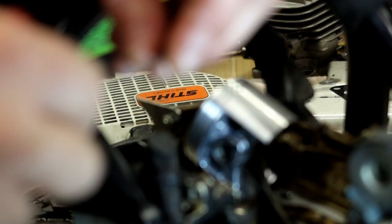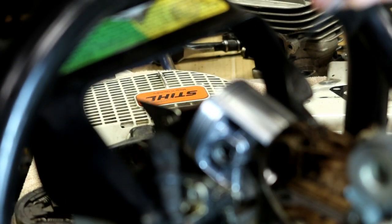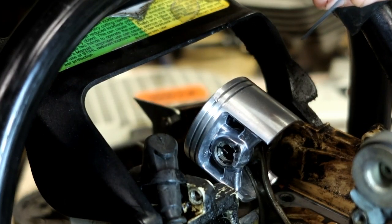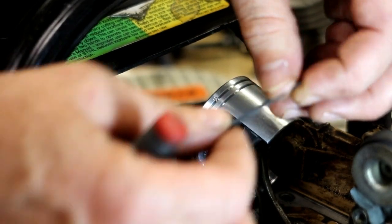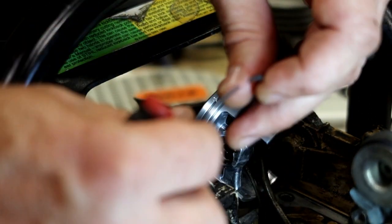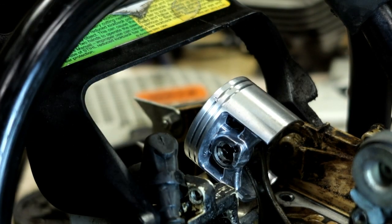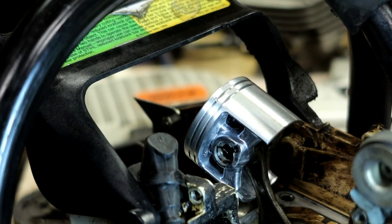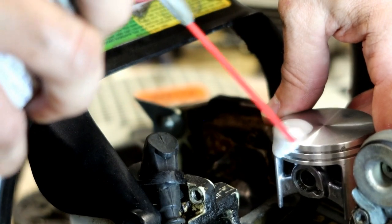And there's a pin here, and then there's a pin over here on this side. Those are designed to keep these grooves from hitting those holes inside the cylinder and catching and snagging and basically breaking them, because these are extremely hard. So what you do, keep them clean, just soap them up with WD-40.